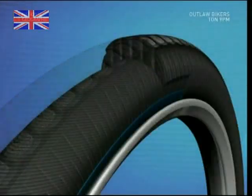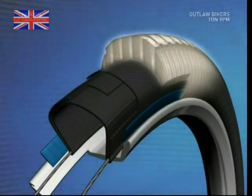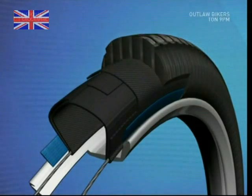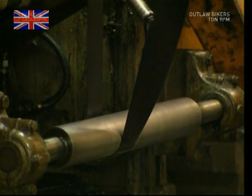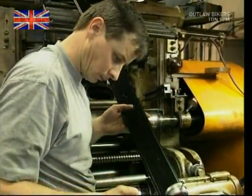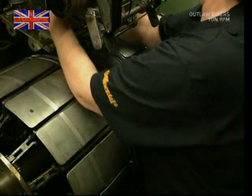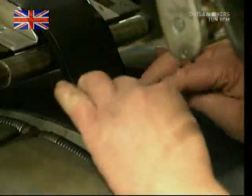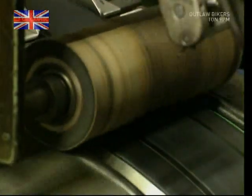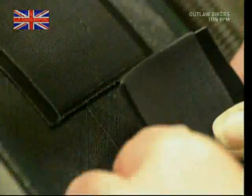And that's the tire's structure. But to be honest, if you tried to ride a bike on a tire like this, it wouldn't be very comfortable or give you much grip. The grip comes from the tread, made from a combination of two layers of hard-wearing rubber. An expert continually measures the width of the two layers, otherwise the composition wouldn't be right and your tire wouldn't grip. The raw tread is sent off to be added to the tire carcass — a layer is wrapped around the drum and firmly stuck down. But it's still not ready to be put on the rim just yet.